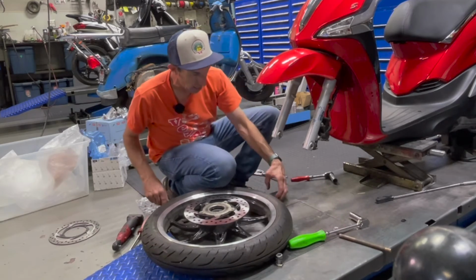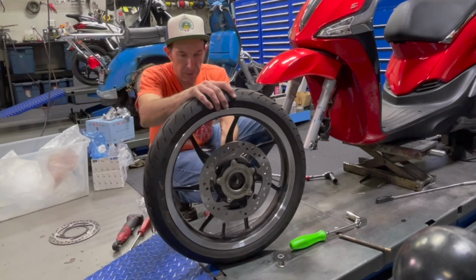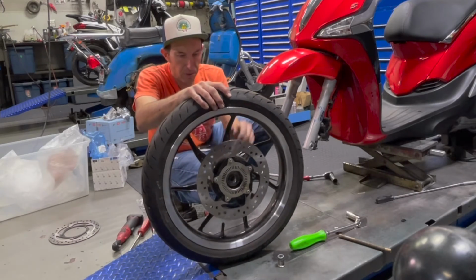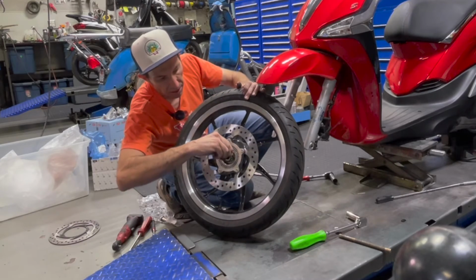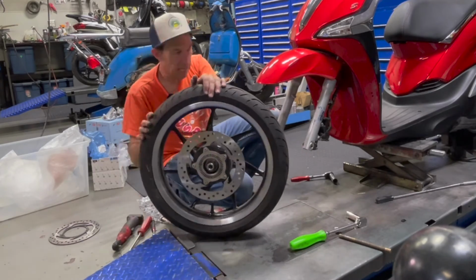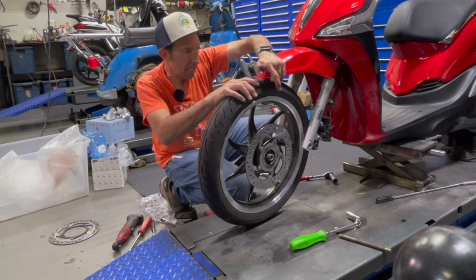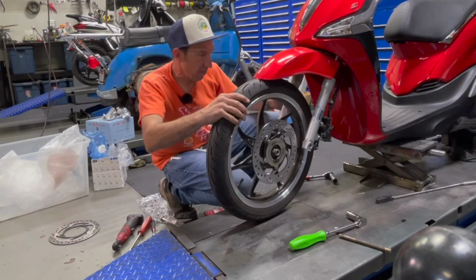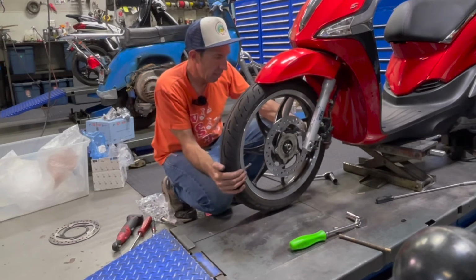There's no problem with that nut. Put the spacers back in place. They do have ample amount of grease. If the grease is old or really dirty, you may want to wipe them out. And they just stay in place. There's 2 oil seals that kind of hold them. And we'll see if we get this in. Technically, you probably could lift the scooter a little bit more, so I'm missing the fender, but I think I'll be fine.